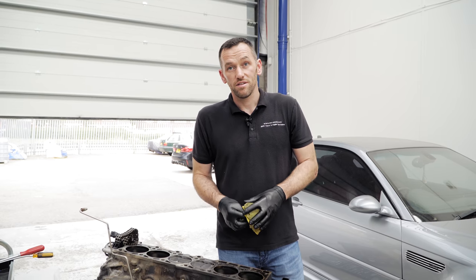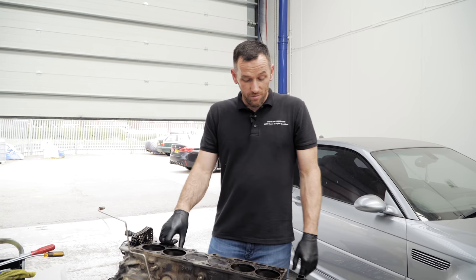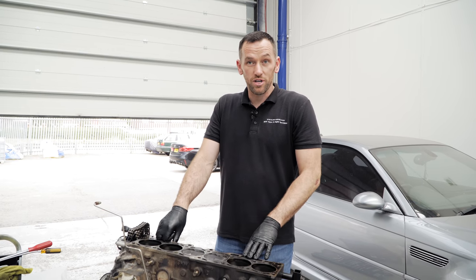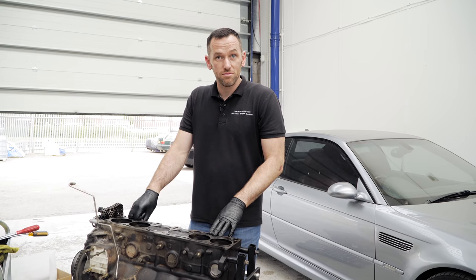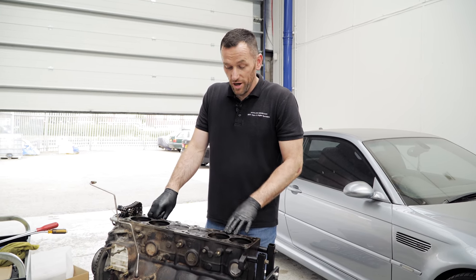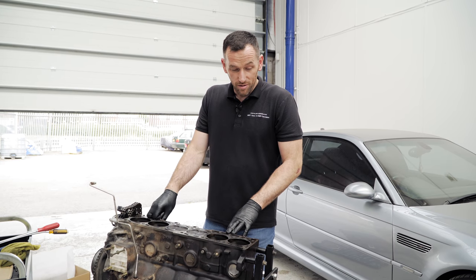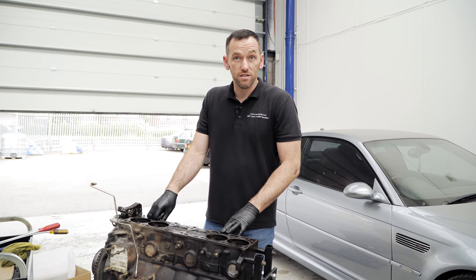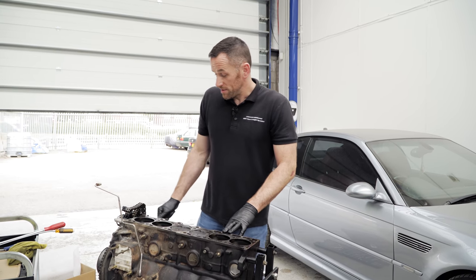The thing is, I looked at that and then the price just starts to get higher and higher. It does, and there's no reason I would. If this was my engine, going in a road car that was a daily, I wouldn't do it. If I was building a nice trick race engine, you'd put main bearings in and polish the crank, but for what you want to do with this, main bearings are fine. You've done the rod bearings and that's really it. All right, that's excellent news then. Yep, nothing aside from that.